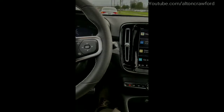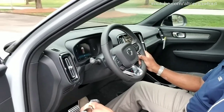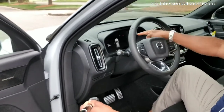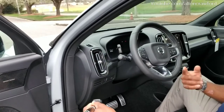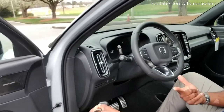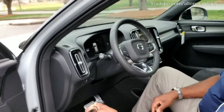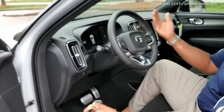The vehicle holds me in place. Now I'm going to show you exactly what happens if you take your foot from the pedal — I come to a complete stop and the emergency brake comes on. Because my driver's side door is open, I can't shift into gear nor take off. What I must do is close my driver's side door, shift into drive, and then I can take off. That demonstrates foot on and off the pedal and what it takes to drive a one pedal drive vehicle.